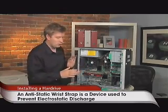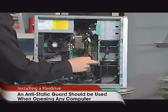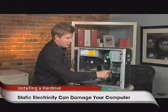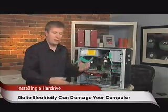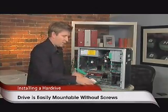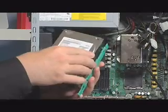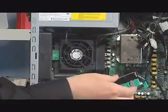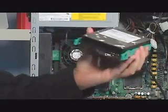When you go to install the drive, my HP computer here has a number of available slots where I can actually put in new items — for example, the hard drive. This is the hard drive that's in the computer right now. I simply pulled out one of these little extenders here and now I'm going to mount the drive. I don't even need a screw anymore. These come set up so that it's really easy to do the upgrades — snap in both sides, one there and one there. That's all four of them, and now I've got the drive mounted.